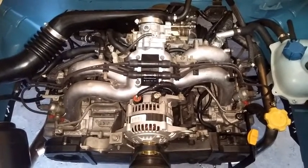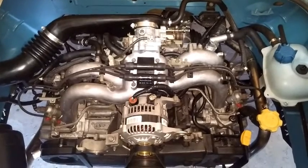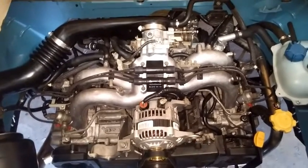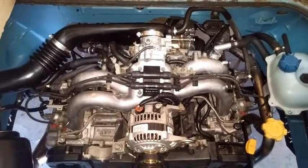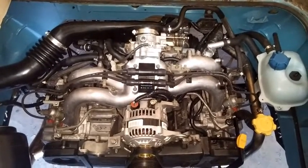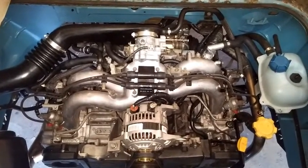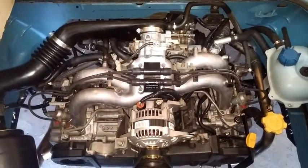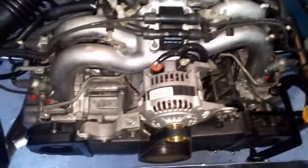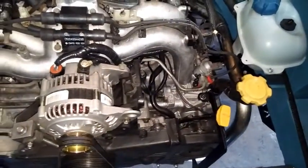The main things that went into the conversion were the modifications and fabrications needed to make this fit from the transmission to the engine. Later Vanagon transmissions fit into a diesel, but you cannot just drive them straight like that because of the different components. So I modified the shifter rod and added bushings. And then here I modified the engine cradle and made these spacers of thick metal, to precision, to support the engine, its vibration and its torque.